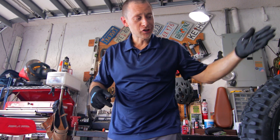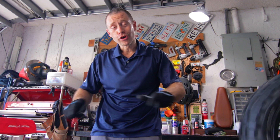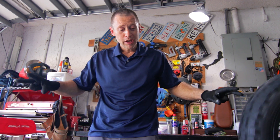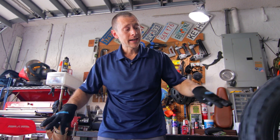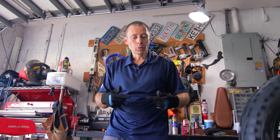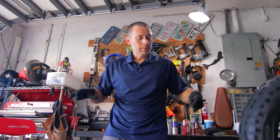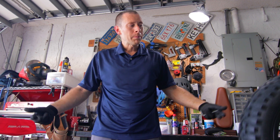So there you have it. We've double-checked everything and made sure everything's tight — that's really important. Make sure you've got your lug nuts up front holding your tire on nice and tight. Make sure your calipers are tightened. Make sure you check your brake levers. Anytime you start off your bike after doing any tire work, I always recommend don't take it over five to seven miles an hour at first. Start in pedal assist one, check everything, make sure your gears are working and the electronics are still going — then just go have some fun.